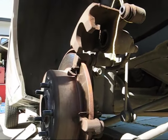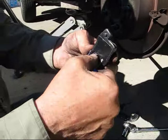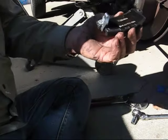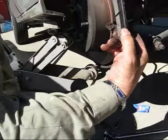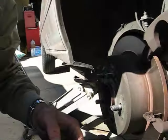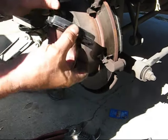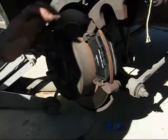Now we want to put the back brake on, but I'm going to put just a little bit of grease — not much, just a little bit — just where the piston will ride on the pads. This is a nice, simple installation. It just slips in. The other side is just as easy — make sure of the curvature, it's going to go into that bracket and into that bracket. Slides right in — look how easy that is.